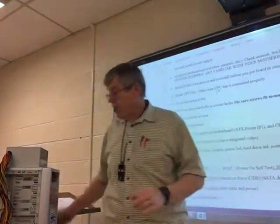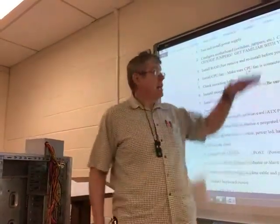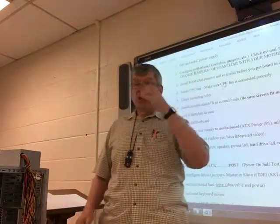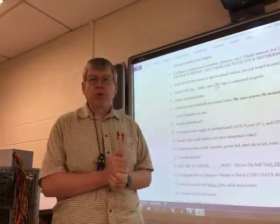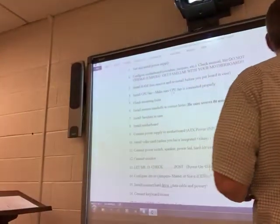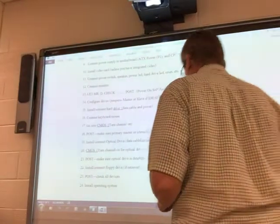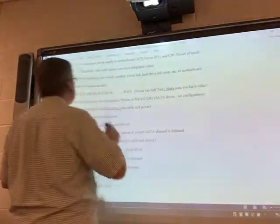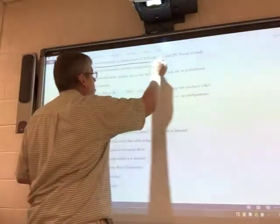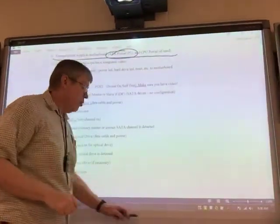Okay. Now, if you were not here and didn't get to do that, that's kind of what you'll be doing today, or reviewing those steps if somebody else did it to your computer while you were out. Okay. Now we're down to step number 9. Connect your power supply to the motherboard. Your ATX power, your P1, your 20+4 pin.